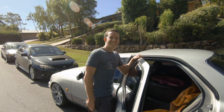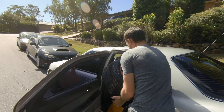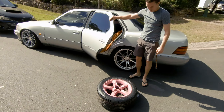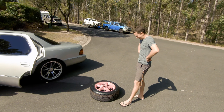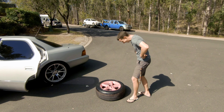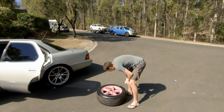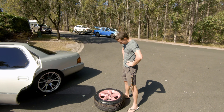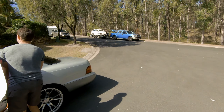Were you bored or something? Just grab them out, mate, you'll be even more amazed in the sunlight. Oh my. I actually don't think it's bad — I actually think it's going to look cool as hell. I was going to do them green with my leftover brake paint, then I had another idea. What's it painted with? It's got glitter in it — I did a metal flake over the top, so it's metallic. Prepped it, primed it, put the pink down, then metal flake — essentially a clear coat with metallic through it — and then clear coated it.